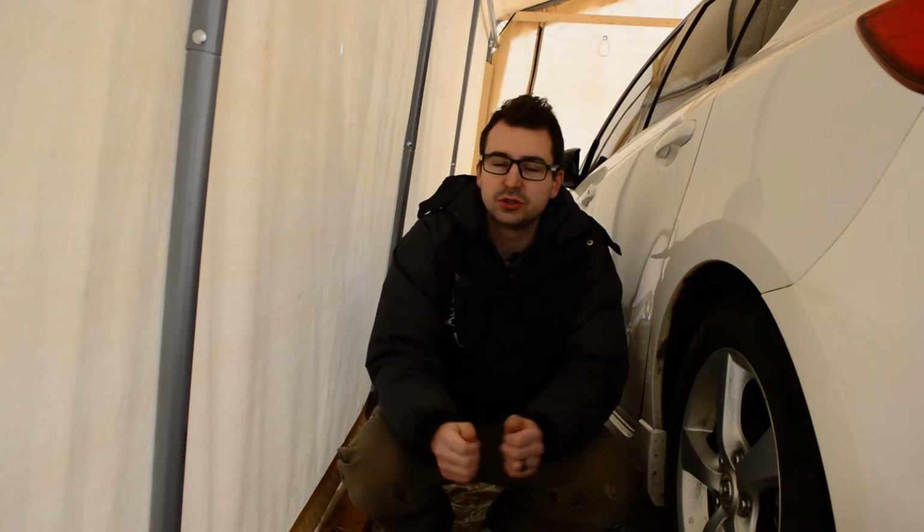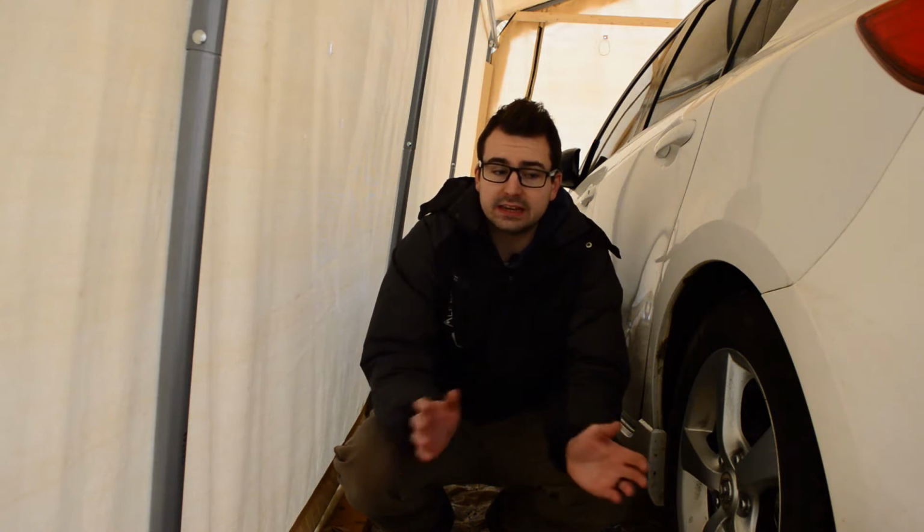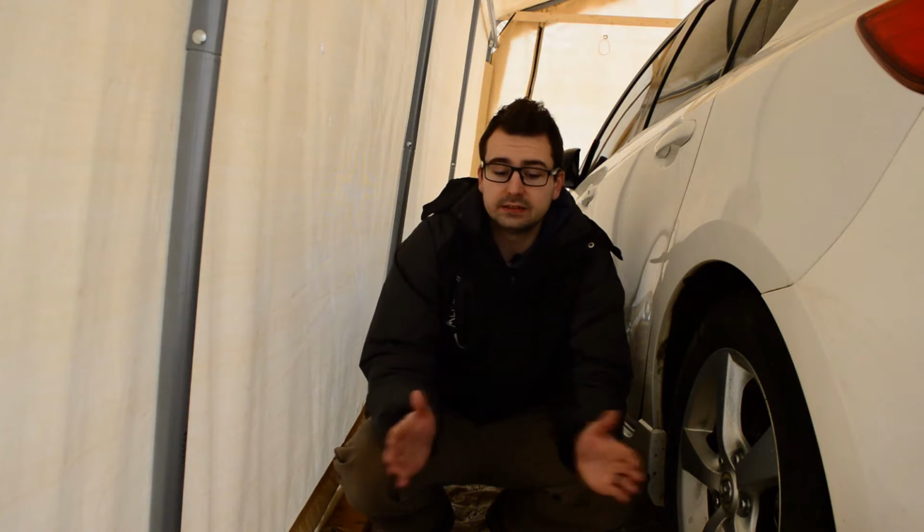So I'm pretty excited to do this modification to put on the Mazdaspeed 3 exhaust on it. It came off from the same generation Mazda 3, but the speed version. I know for a fact that the axle back bolts up to the exhaust, bolt on. For the mid pipe area, I'll probably have to cut and get some pipe welding to extend it